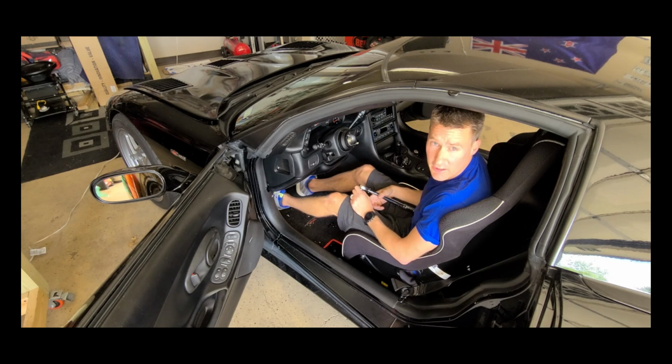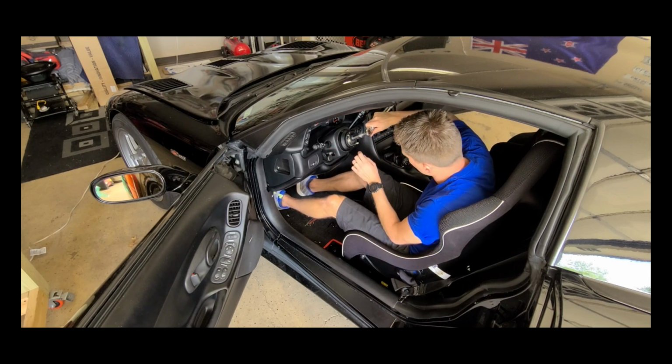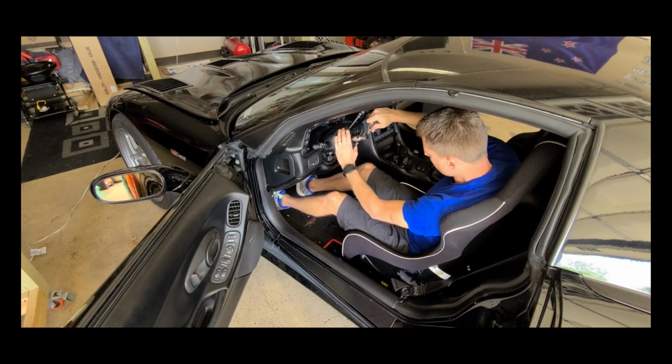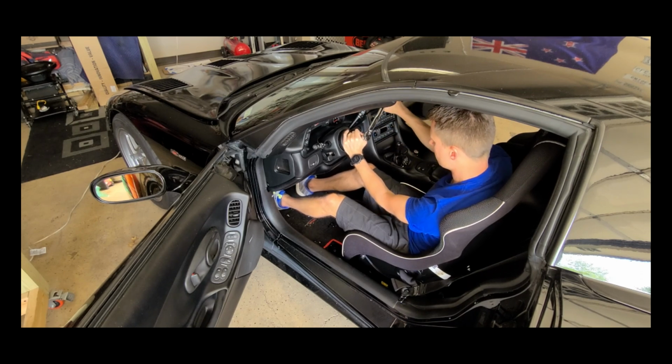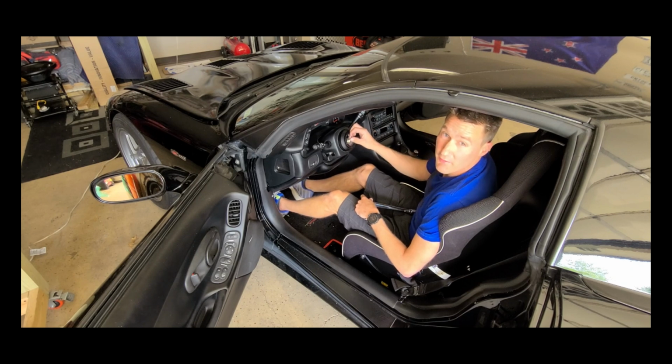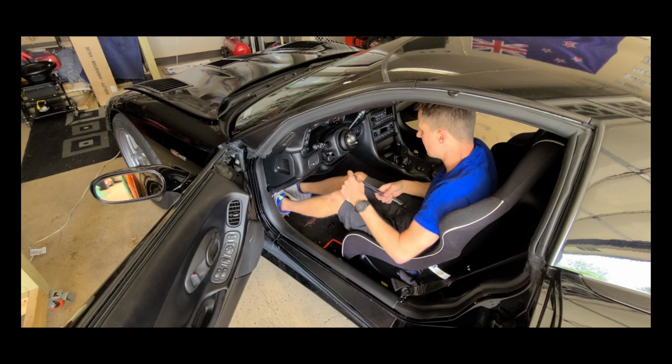Alright, now that's taken care of. Let's torque the nut. 30 foot-pounds for this vehicle. You'll notice I've left the horn ground on here. I'm just going to store it in here for now. Maybe when we pull this off one day, we'll connect it.